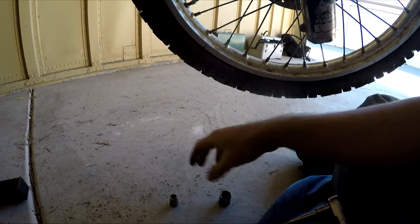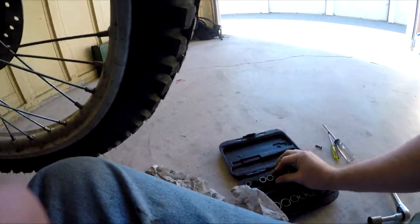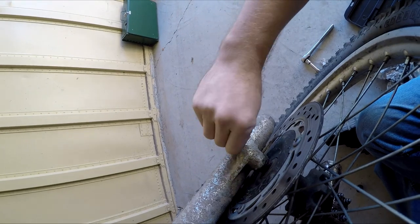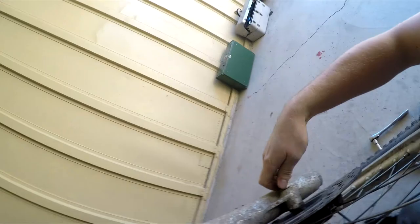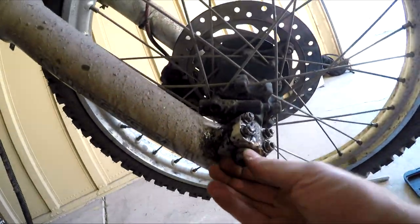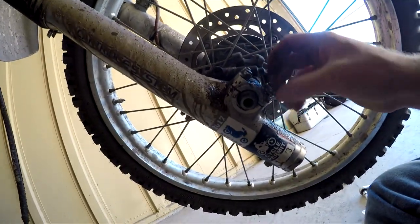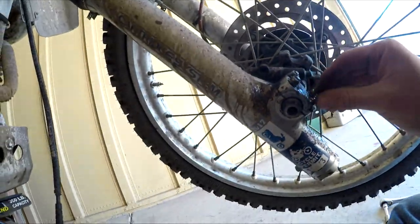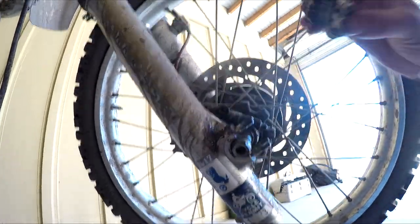This larger one is a 17 millimeter. I sure hope you're not using American standard stuff on a Honda motorcycle. There's a second nut over here — I thought it was a 13, but it's actually a 12 millimeter. This little piece comes out and it's hooked into the shaft, so it won't come apart unless you do that. This should start backing out now — there we go. When you put this back together, there's an orientation indicator right there so you don't flip it the wrong way.